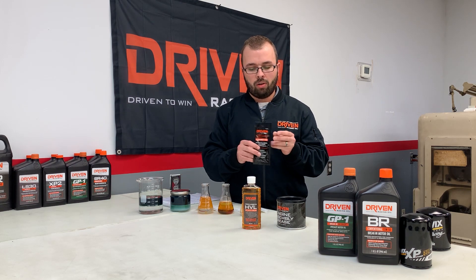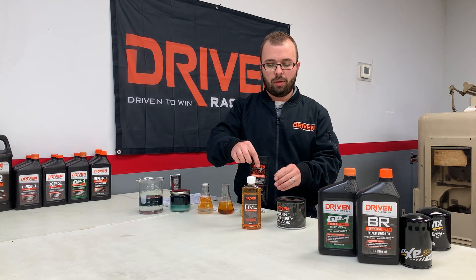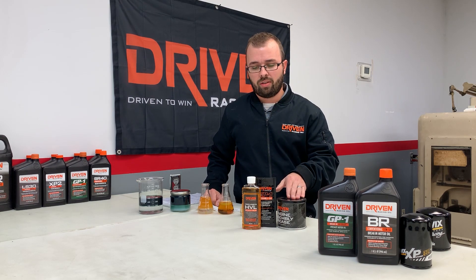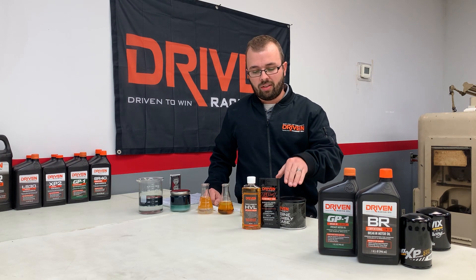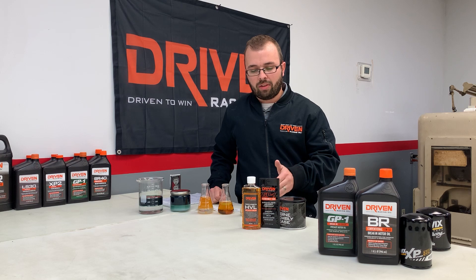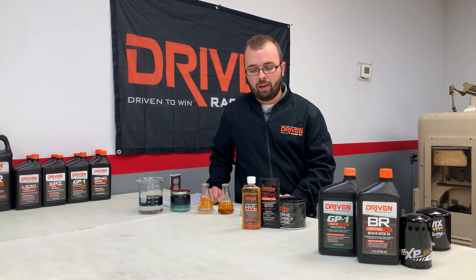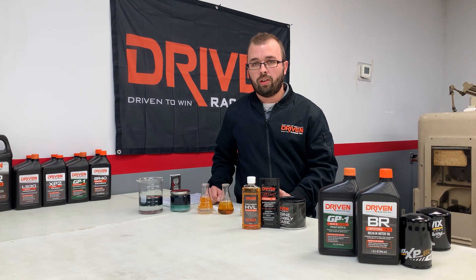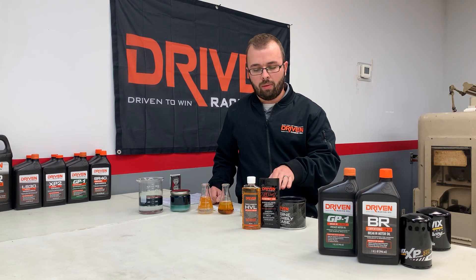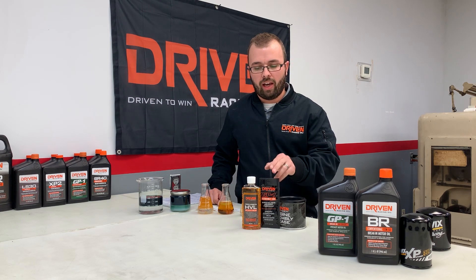There's also a new product — the GP1 Assembly Gel. It's a no-drip special formulation that sits in between a lubricant and a grease — it's actually a gel compound. Like the grease, it stays put and won't drip off. Testing with Comp Cams' spin testing showed it made a measurable difference when an engine sat overnight compared to competitive assembly lubes. The other advantage is that because it's a gel compound, it doesn't have thickeners like a grease does, so you get better additive response from the additive package mixed into it.